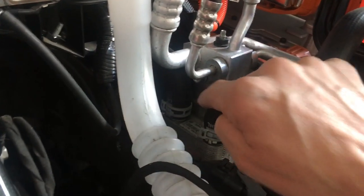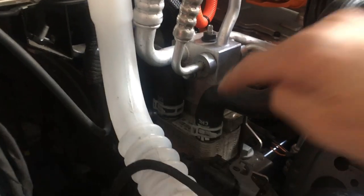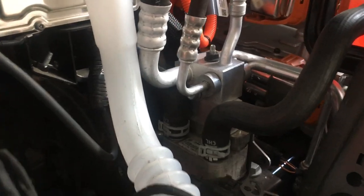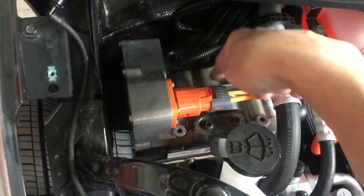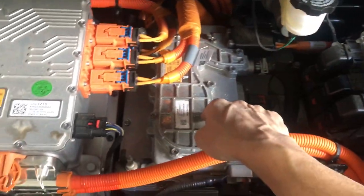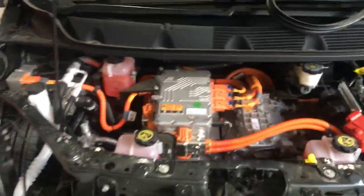This is gonna be things you're gonna have to diagnose. Overheating batteries, look at your AC system. Forget about the passengers, not important anymore, because you gotta cool electrical devices like this. It's about thermal management, not passenger comfort.